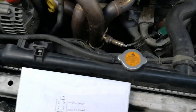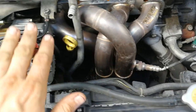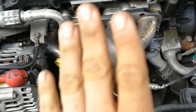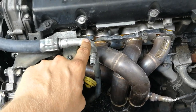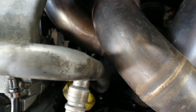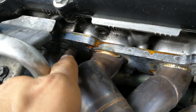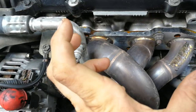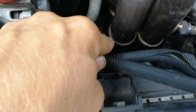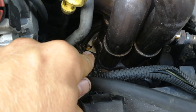Fans are done. Next, get the 2J Racing header in. With the alternator gone and all the brackets out of the way, the header should slide right into place. You'll have to move the AC line just a little bit because the clearance is tight. Move it just enough to get the header to clear the studs, and as soon as it goes on those studs it should pop into place. Make sure that it's seated on the bottom at your downpipe too.